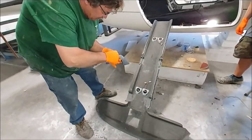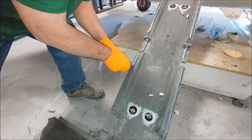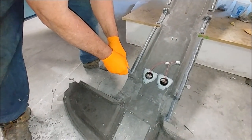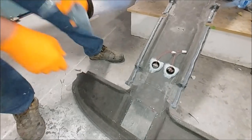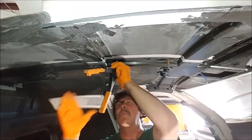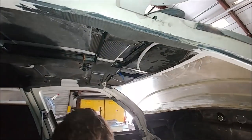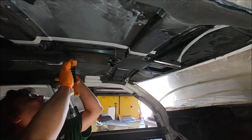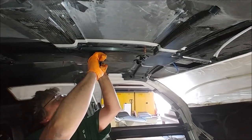Here's Jeff in the process of getting ready to bond the overhead roof chase in place. He's got his little cake mix thing — a baggy with the Hysol mixed in — and just laying it out like he's icing a cake; that's the most efficient way to get it on a flange like that. With this one going into place, all that's left on the roof would be to bond in those hard points for where the seat belt brackets will mount. You can see Jeff's got it laid into place with the Hysol and he's putting some pop rivets in there to hold it nice and snug as it bonds up.